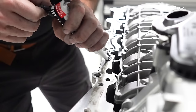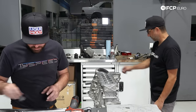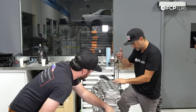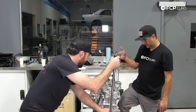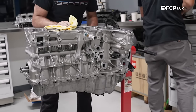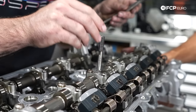Basically you're looking at a complete bottom end here. The oil pan, oil pump drive, timing chains in the back — all installed. All six pistons and rods are installed and torqued. We're going to spin this thing over by hand to make sure everything feels the way it should. When you spin a motor over after doing all this kind of work, you spin it nice and easy using two fingers — make sure nothing feels like it's binding. Everything's looking good. We installed the head gasket, got the cylinder head all cleaned up, prepped the surface, removed all the old gasket material, and installed the ARP 625 head studs. Michael's laying in the head bolt washers, and then we're going to torque this head up.